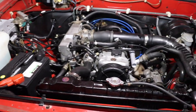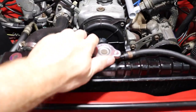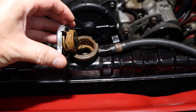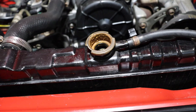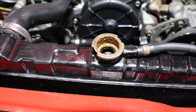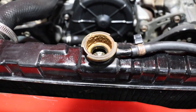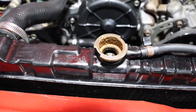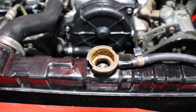Now that we have a nice clean engine bay, let's get it a little dirty by flushing this cooling out. Underneath this radiator cap is something not too great — lots of crust, rust, just debris. Now that's not like your traditional milkshake-y situation. If you see brown in your coolant, people freak out thinking the head gasket's gone. But when it's crusty like that, it's rust. It could be in the heater core, anywhere in the cooling system, usually the radiator as well. We're going to do a really intense flush and get that running clear again.